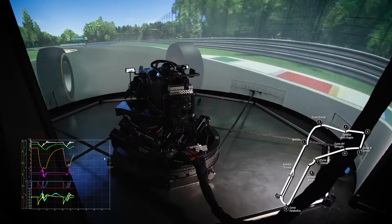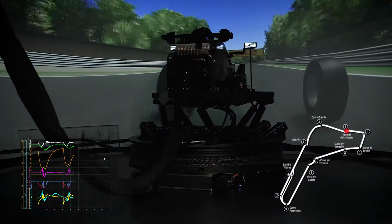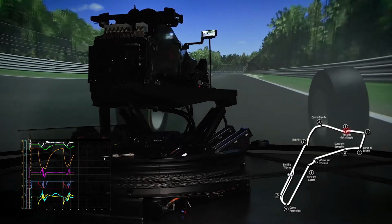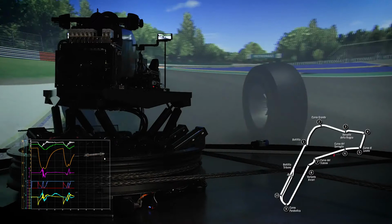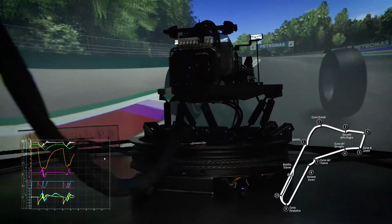Then, while approaching the turn, the driver releases the brake pedal to modulate the deceleration. During this maneuver, the disc frame first moves quickly backwards and then, because of the large available longitudinal workspace, follows the action of the brake pedal, giving a proportional feeling of deceleration. For this maneuver, the disc frame is pre-positioned forward so that the entire longitudinal workspace can be exploited.